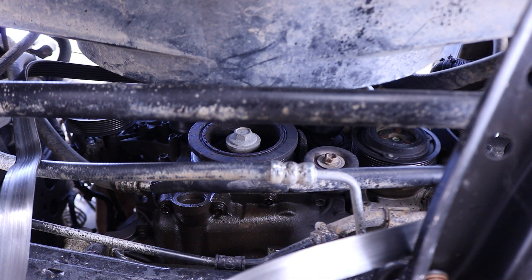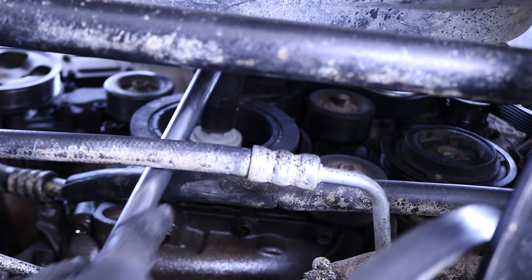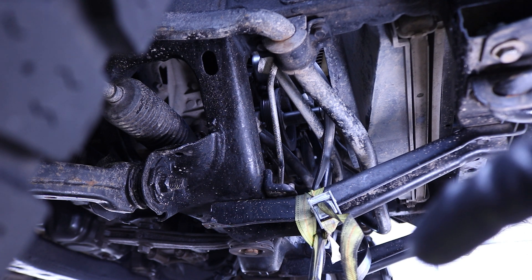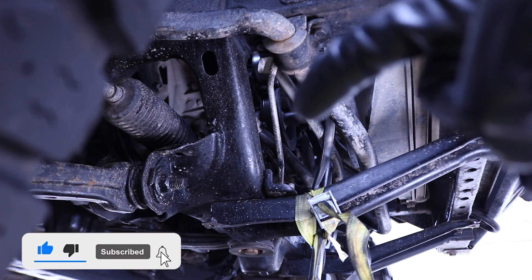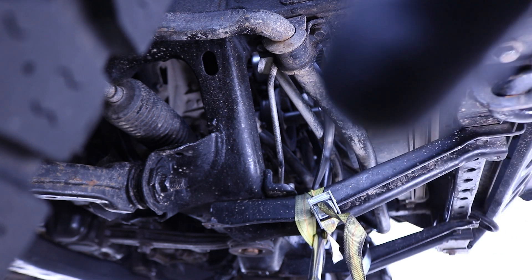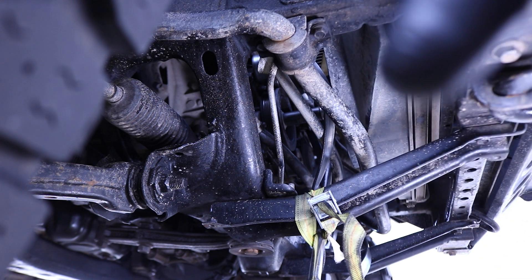What I've done is pretty much have the belt hang out away from the crank pulley because we're going to be bumping the starter while we have a socket attached to that thing so we can undo that crank pulley bolt. I have a 22 millimeter socket and a breaker bar secured onto that crank pulley. I took the breaker bar and have it secured onto the crank pulley, then strapped it so that when it rotates clockwise, this bracket here works as a stationary object, fixing the breaker bar in place. When I bump the starter, the whole thing doesn't drop.